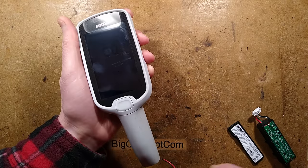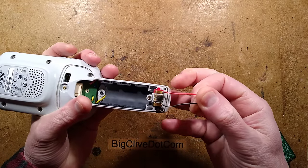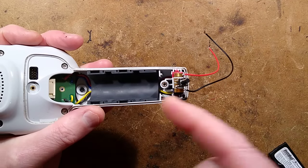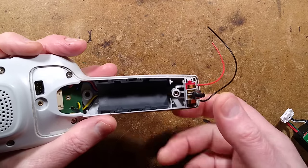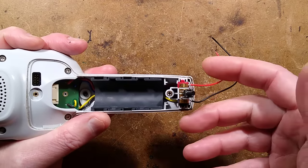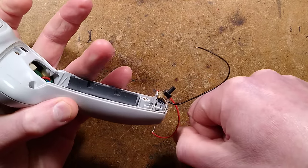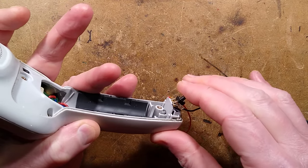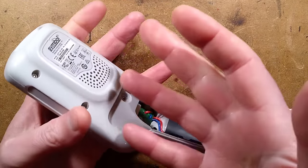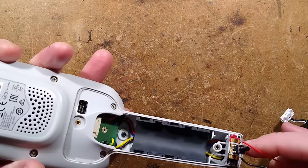I shall disconnect it now. To power this up, I connected a couple of wires onto the back terminals here, because I don't have the charging base for it, owing to the fact that it would be quite expensive. This little button is just tacked across the two middle terminals, because there is a little probe you can get - when you press and hold the reboot button and put your probe in, it shunts these terminals at the back. On non-lockdown devices it can recover into a sort of recovery mode and let you do things, but that's not happening.